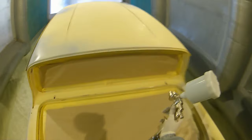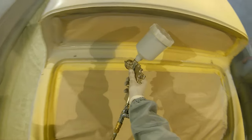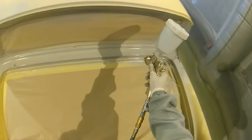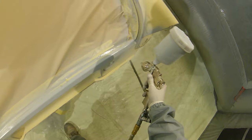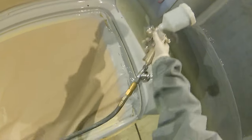So guys, we're going to go for the actual build coat. Now, we've given that a good, I'd say 15 to 20 minute flash off to let that really seal up those areas where the lightweight filler is, where the finishing filler is left, and also where there's the harsh little breakthroughs on the actual paint surface. So you'll notice on that first coat I did go really quick with the gun, because although I want a wet coat, I don't want a heavy coat. I just want a nice light coat over the area to seal it up.